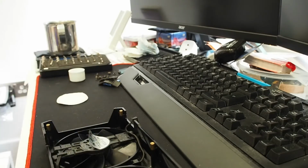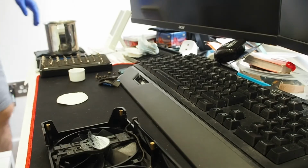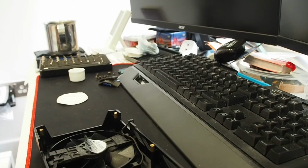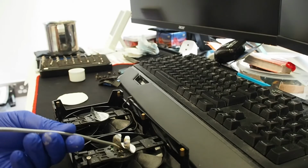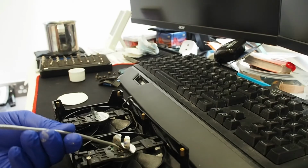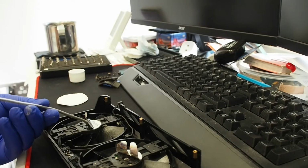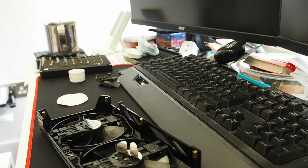Yeah, that's it. Let me get some WD-40. This was a bit unexpected. WD-40 is something basic. You should probably use some specialized grease for bearings like this, but again, even a basic service is better than nothing, and I don't have any specialized grease. So, gonna squeeze really gentle. There it is, that's a drop there, and that's it.